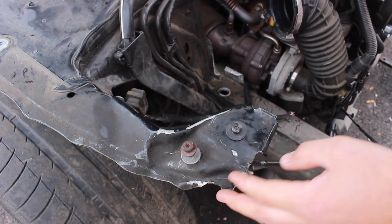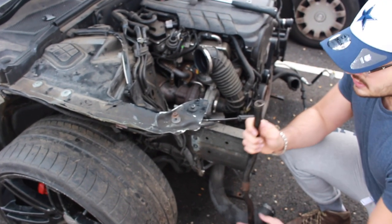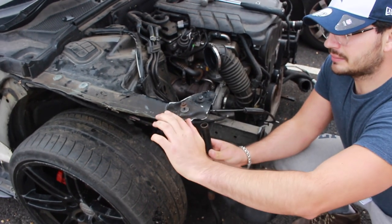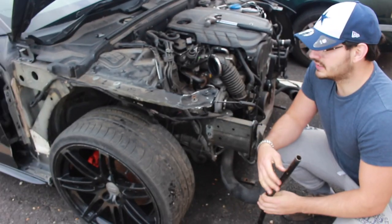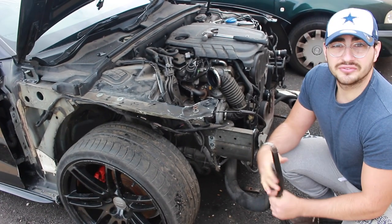The way that I've pushed it up — because it was quite far down — I got a pole, basically put a trolley jack underneath here and jacked it up, and it managed to push the frame upward. It has crumpled it slightly up here, but maybe that's something we can sort out in the future. I'm going to carry on pushing that up or in by just hammering it slightly. I'm just going to offer up the new slam panel and make sure that it fits right.